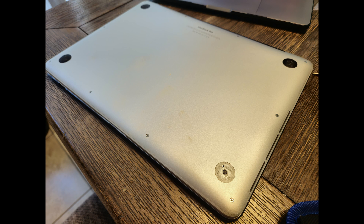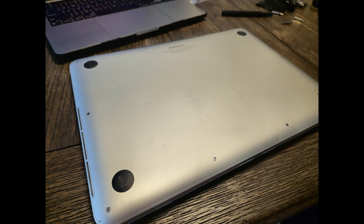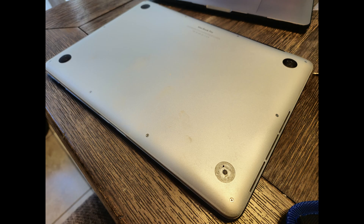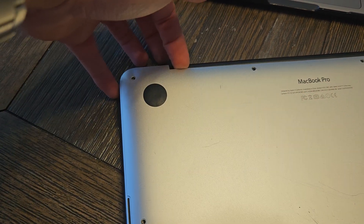Shutting down the rear back of the MacBook is super easy to take off — there are 10 screws. The two in the top middle are a smaller size than the rest, but you don't really need to keep track. One of the feet is missing; we used a sticker to plug up that hole since there's a hole that goes through the MacBook shell. The back panel is secured with two clips in the middle, and you can just firmly pull up.